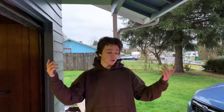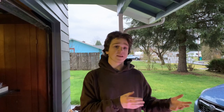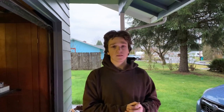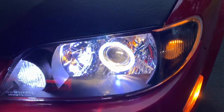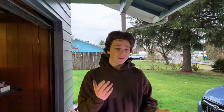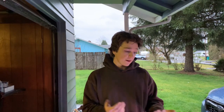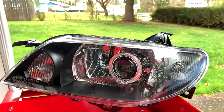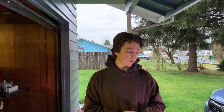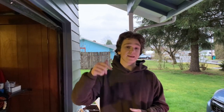The install went pretty smoothly besides a blown 15-amp fuse for one headlight — I kept troubleshooting trying to figure out what was broken, and then I found it was just the fuse. The angel eyes — the halo ring — look really cool and make the car look really modern. The headlights are brand new, no scratches, super clear and clean. I got the harness from Harness Performance on Instagram and the retrofitted headlights off eBay — they came pretty quick and everything worked well. Drop a comment, leave a like, and subscribe!